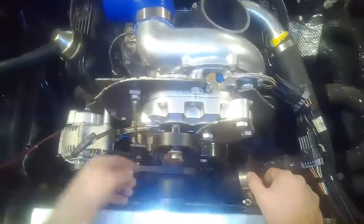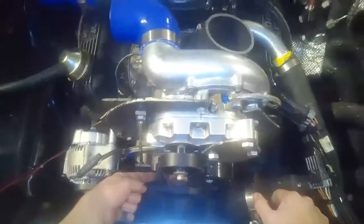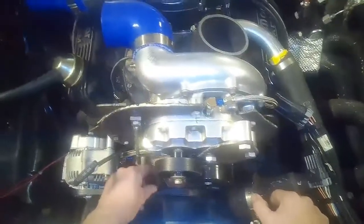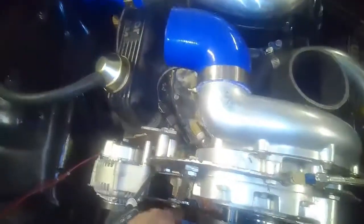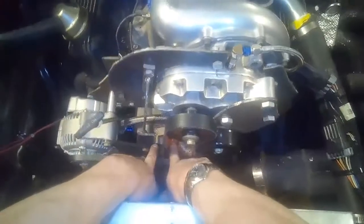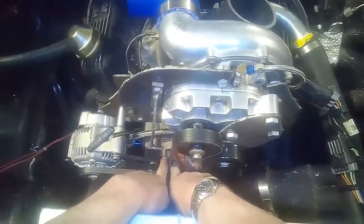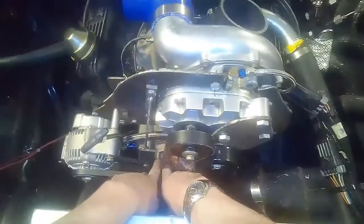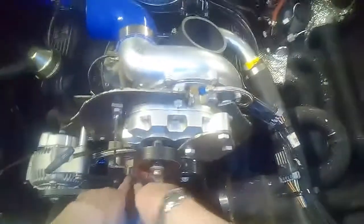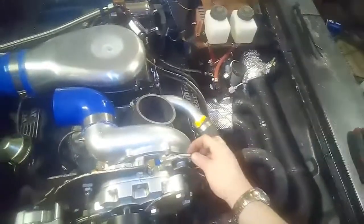on these belts, this slack side of the belt tends to wobble around pretty good, and it would end up making contact with our water pump at different places down through there. So I may end up having to put a kind of an idler in there just to limit the amount of wobbling that it does when it's running. But we're plumbed up with an oil supply.